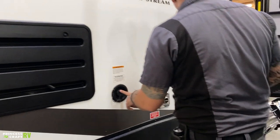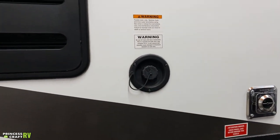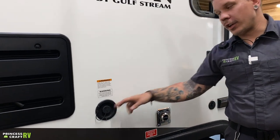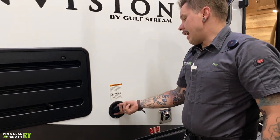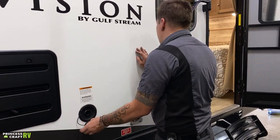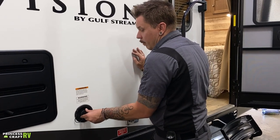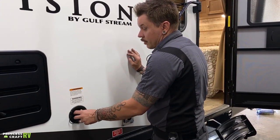We have your potable water fill here. That's how we fill the onboard water tank. If you're doing any dry camping, fill this up before you get there — stick a garden hose directly in and fill it until it overflows. Once full, cap it off. We use that onboard 12-volt water pump to draw that water up from the tank to the fixtures and make it usable.